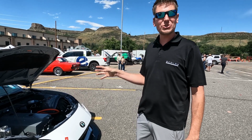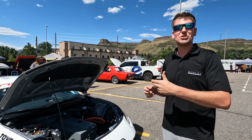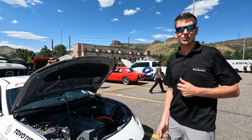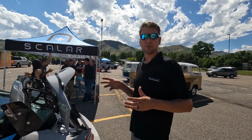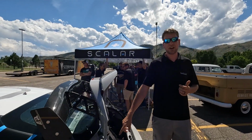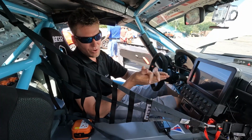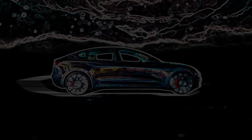It's based on a 2022 Toyota GR86, a thing that you can take to the track and actually spend the weekend racing. There's no turbo spool up, there's no supercharger. The motor is a Stealth EV motor. Its potential is about 500 horsepower, about 550 foot-pounds of torque. There's a dry sump oil tank in the back here. These are the oil coolers you'll see in the back here. We run their standard 5-pound fire suppression bottle.